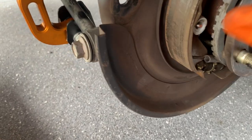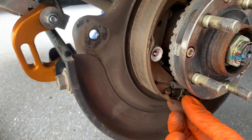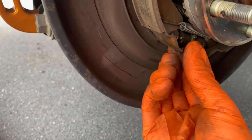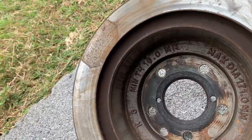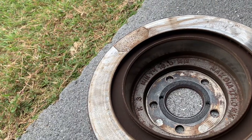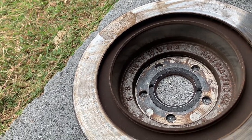The handbrake shoes were just — everything's tight here. I don't know if we're going to have to adjust that. There's a little spring here to wind it back. We might have to adjust that a little bit to get these new rotors on — it's just not much wear. These look like the same as the front, same markings. I'd say they're the originals. I've got record of them being machined but not replaced, and he's got service records from new. So anyway, fresh rotors to go on the back.